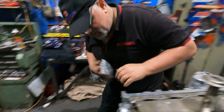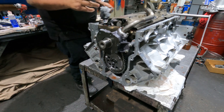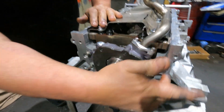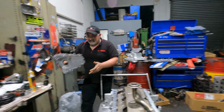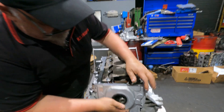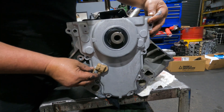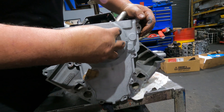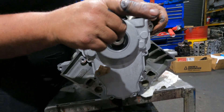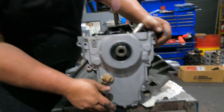I'm going to pull the block out a bit because I can't use the tool I made for this before. To line up the seal - there are no dowel pins to hold the timing cover, so the cover floats on everything. I need to centralize the seal. I had a tool that does this, but because this crank has a keyway and my old tool was cut from a harmonic balancer without a keyway, I can't use it - not all cranks come with keyways, only the special ones.